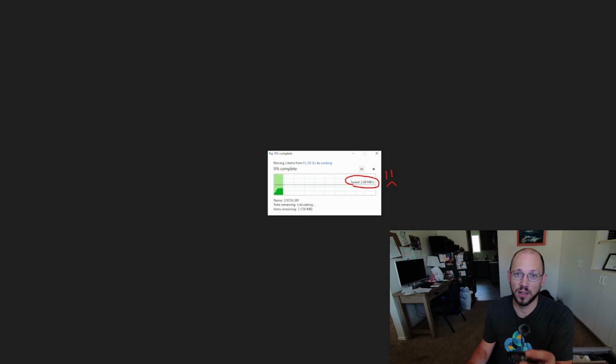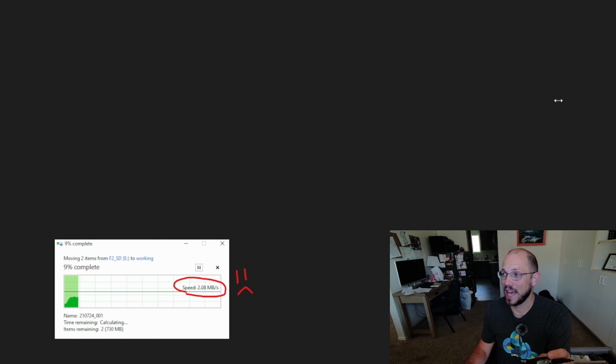And this is one of those things that's kind of annoying about this particular unit. It's USB-C, but it doesn't have USB-C speeds. It's actually using USB 2.0 fast USB, and the connections are severely limited. So I have a screenshot here of how sad it is. Look at that. So I'm transferring data using the USB Type-C, which I assume would be USB 3 speeds, but it's not.